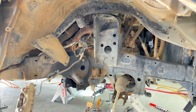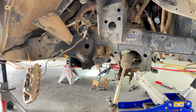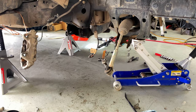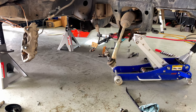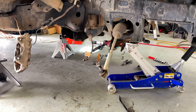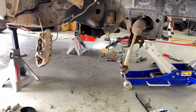We've got almost everything off here — brakes are swung out of the way, shock is out, spindles out, hub assembly, lower control arms. Let me tell you, those did not come out easy. All we have left is welding in the cam tab gussets, and the rack is getting ready to come out, so we're getting close to a full strip of the front end.